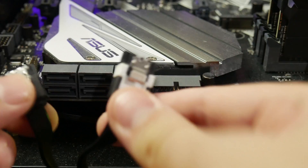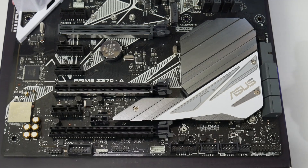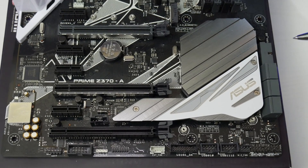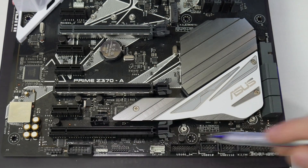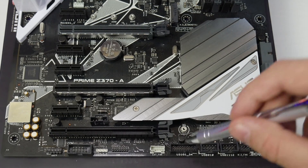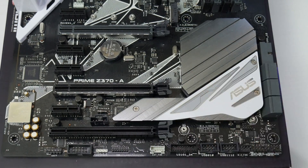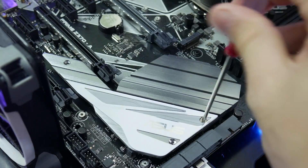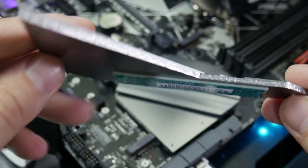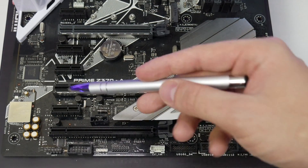Moving to the bottom of the motherboard. On the side there are six SATA 6Gbps ports. They've removed the SATA Express ports, which is fine since it never really took off. There's a USB 3.1 Gen 1 connector on the side, which I'm really happy about - there's also one at the bottom, but bottom-mounted USB 3.0/3.1 connectors are awkward to cable without stressing the connector. The Z370 chipset cover is removable and underneath it there's an M.2 port, which should keep your M.2 SSD cooler away from graphics card heat - though in SLI it would be underneath a card.